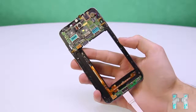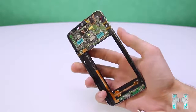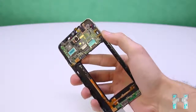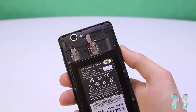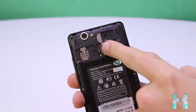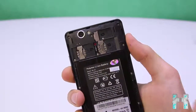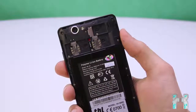Press volume down, keep it pressed, then connect your smartphone to the computer and see if it gets recognized. If that doesn't work, try a different button like volume up, or maybe power plus volume down — that depends on the smartphone. Some smartphones also have a reset button. If you have a device with an integrated battery, like the THL5000 or any iPhone clone, those devices usually have a reset button. On some iPhone clones the reset button is between the volume buttons and very hard to find. Be sure to check if there's a reset button to trigger preloader or META mode.